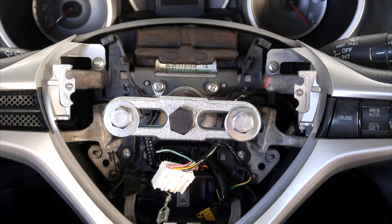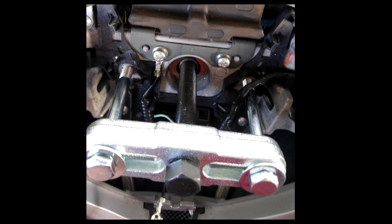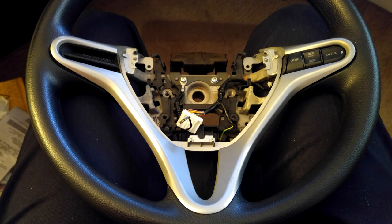I wasn't so lucky, so I went down to AutoZone — $20 deposit, free when you return it — and got a steering wheel puller. Attach it with the three bolts: screw the two side bolts into the wheel, and the center one puts force on the hole where the big bolt was. Tighten it up, make sure it's level, and make sure nothing's bent — the first wheel puller I got was bent and doesn't work. Put the force on it, you'll hear a pop, and the wheel will be loose so you can slide it right off.